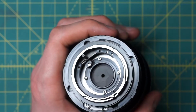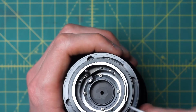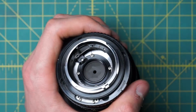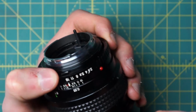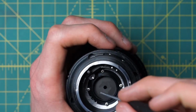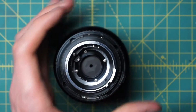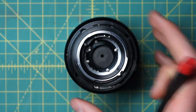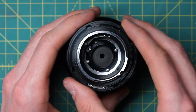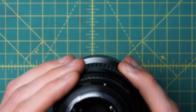the blades are moving some. Another thing you could have done, which I mentioned during the disassembly originally, is score the aperture blades when you're initially taking apart the lens, if you believe the original aperture setting is correct and you want to match that. You can also take photos and try to match it up, but it's an imprecise thing in general unless you do have some sort of marking. On a small aperture like this, it's still generally imprecise, and it doesn't really need to be absolutely perfect. In most cases, you're just looking for making sure that each stop has a bit of movement and that the aperture settings are generally in the right range. So I'm pretty happy with where this is currently.